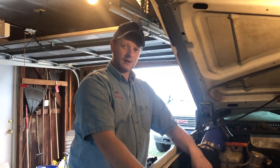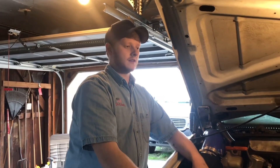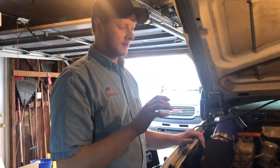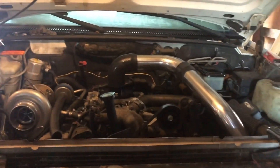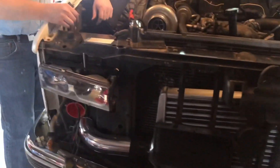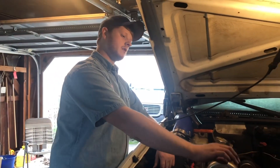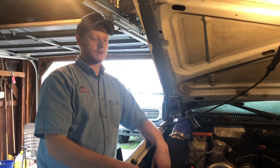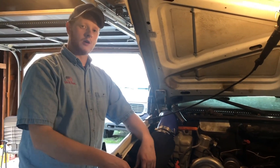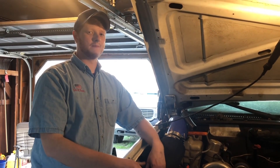Hope you guys like our little beginning of the intercooler mock-up stage. It's not exactly orthodox right now — I have an itty-bitty garage and we're making it work. Hopefully this will show some of you guys that yes, we can front-mount them. It sucks that I don't have air conditioning to show you what the condenser takes up, but the A/C condenser only takes up about an inch and a half of core support space. So hypothetically we could shift the radiator forward and do the exact same mounting. Hope you guys enjoy, keep tabs on us, because exciting things are going to happen into the wintertime. Thanks.